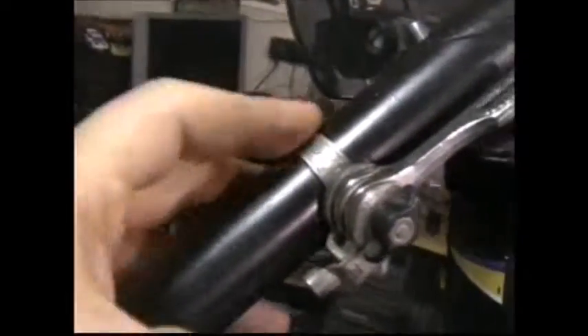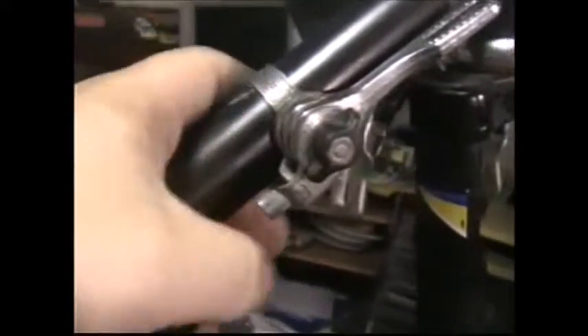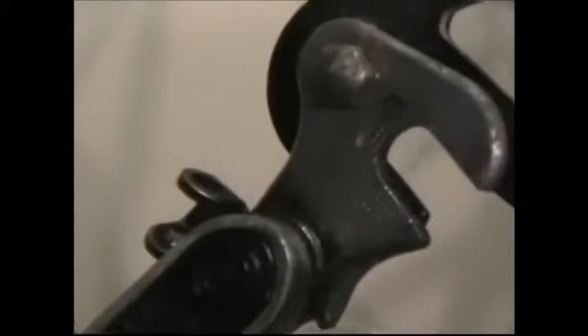As you can see it just goes around the frame like that. You just open up the clamp, push it over, squeeze it shut, and pop your bolt through. That's just how the back derailleur goes on. You've just got to line up this slot.